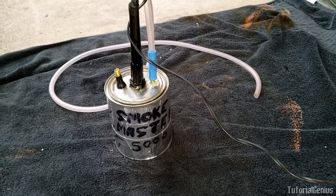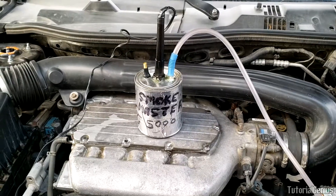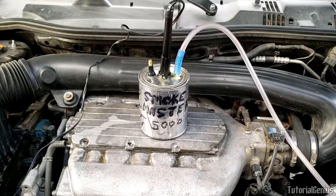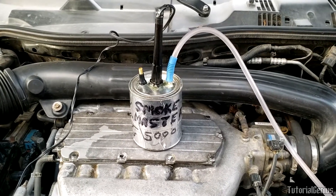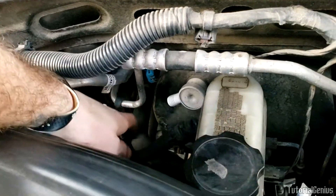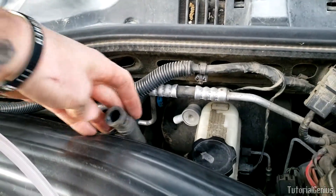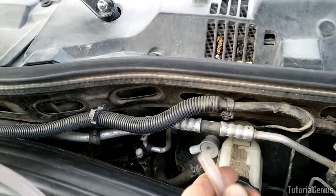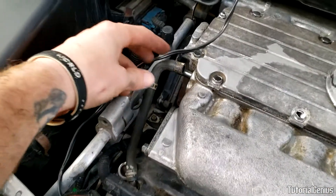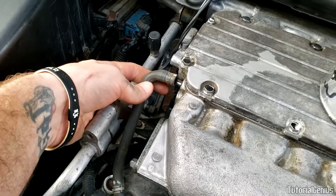With the air compressor attached to the inlet, there's a lot of smoke and it just kept coming. So let's put it to the test on a car. Here's a typical scenario: I've disconnected a vacuum line — this one off the brake booster — and placed our outlet hose right in there. I've also simulated a vacuum leak by simply unplugging a line.